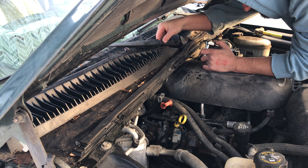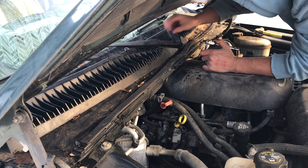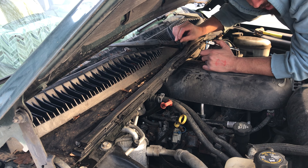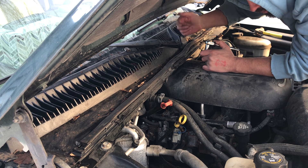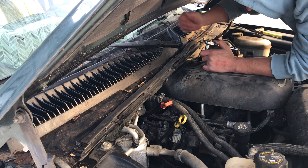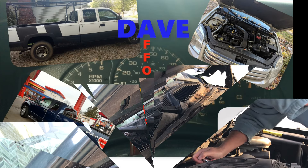This is the same for a lot of vehicles. A lot of times they get stuck because they've been on so long. You basically want something prying up on this while you tap on that, and you want the nut on so you don't mess up the threads. The screwdriver I use works great on mine — it might be different for each vehicle, but there you go.